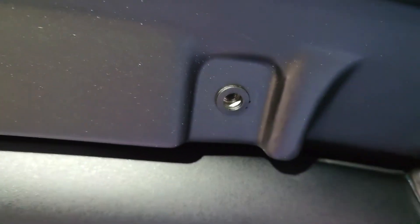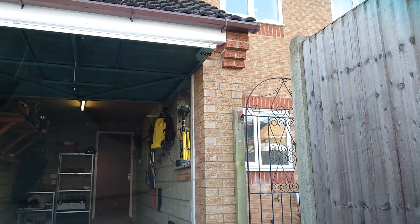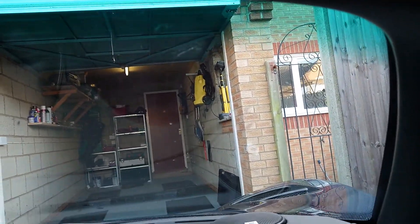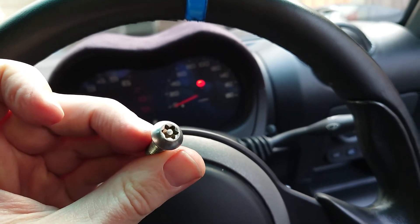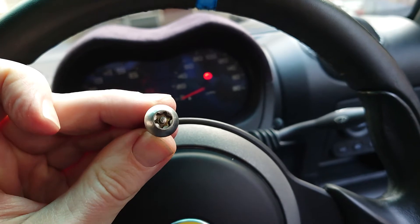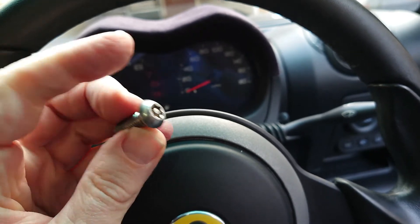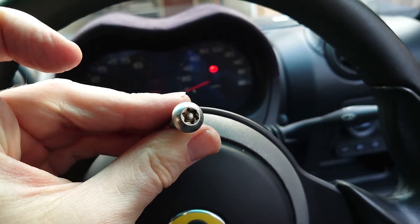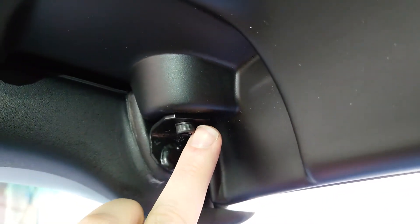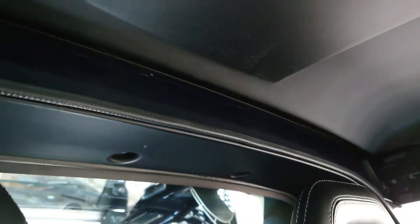In keeping with the slow carbon fibre takeover of my car — a few things to note: despite watching a couple of YouTube videos, you will need some special tools, not just normal allen keys. On the original hardtop you'll find hex head security bolts. Fortunately my local Screwfix, literally two minutes down the road, had a set of adapters, so I nipped down and got those — otherwise I wouldn't have been able to get the hardtop off. In the original fitting, these take the place of the bolts in the corners and also the two centre bolts in that rear tab, which is no longer used in this fitting.